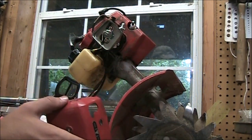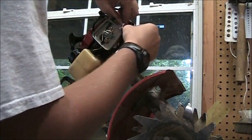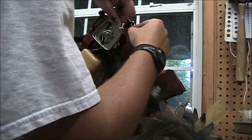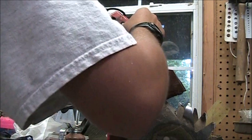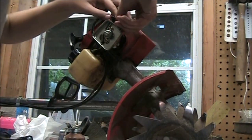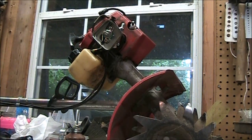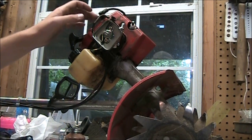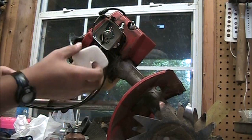And you want to get that screw. Oh, first, actually, we're going to put the throttle on before anything else, just to make it easier on us. You can pull the throttle butterfly up a little bit so that you have a little bit of extra space to pull this little throttle cable in. Now you can test it, make sure it moves up. Yes. I ended up not taking off this throttle here just because I didn't see a need to. I was thinking I needed to take it off if there's not enough space to get to everything else, but it looked good, so I just left it.